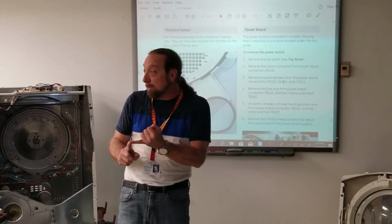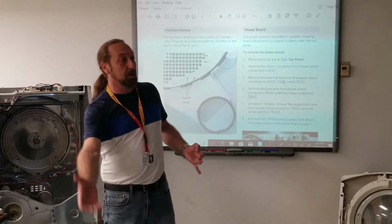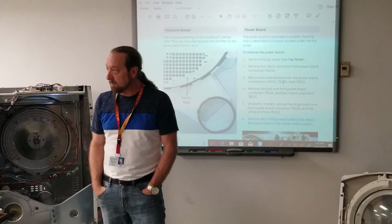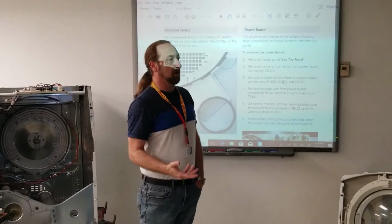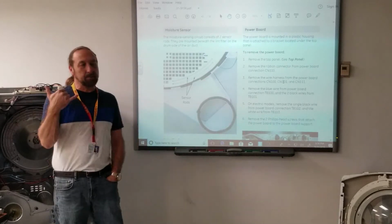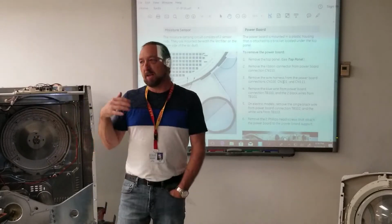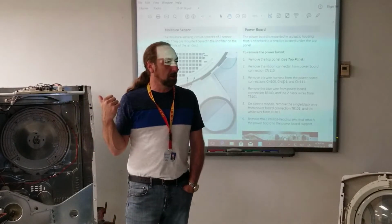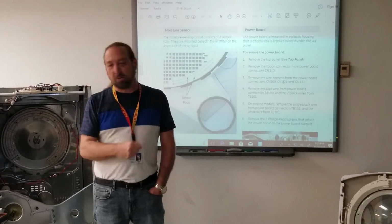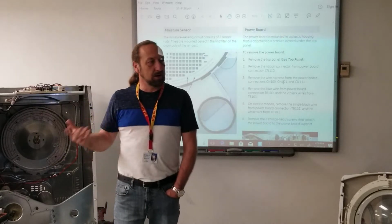And you check the temperature at 160 degrees, the drum's turning, there's no holes in the back, the airflow is beautiful, but yet clothes are still coming out wet. And it may be what the customer's drying. So sometimes, before I even go to the customer's house, I say, "I see your clothes are not drying properly. Could you have a load of clothes that you would normally put in the machine ready for me?" I'll put it in the washer, just get it soaking wet, spin it out, and throw it in the dryer, and I'll see if this dryness sensor is not drying properly.